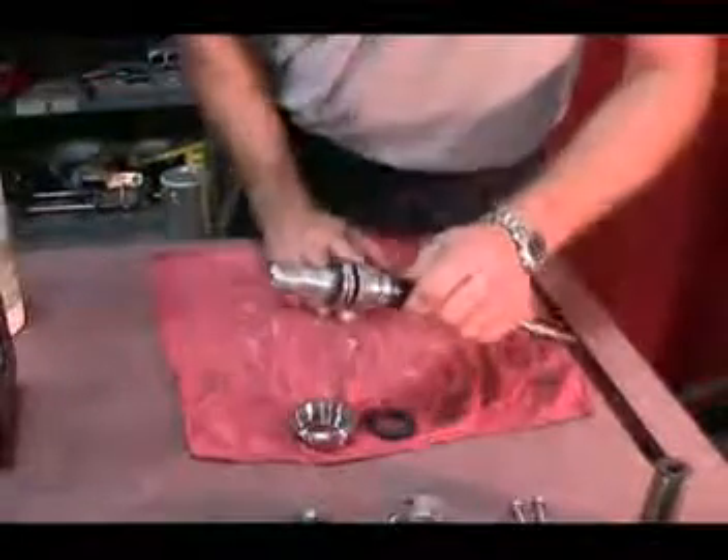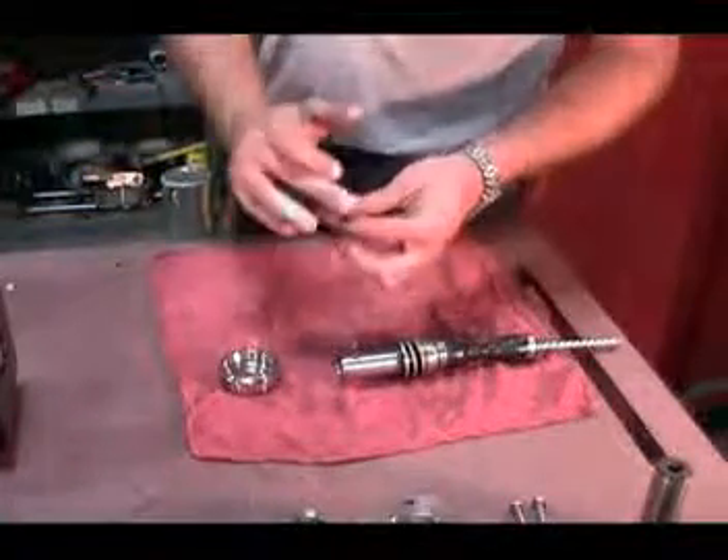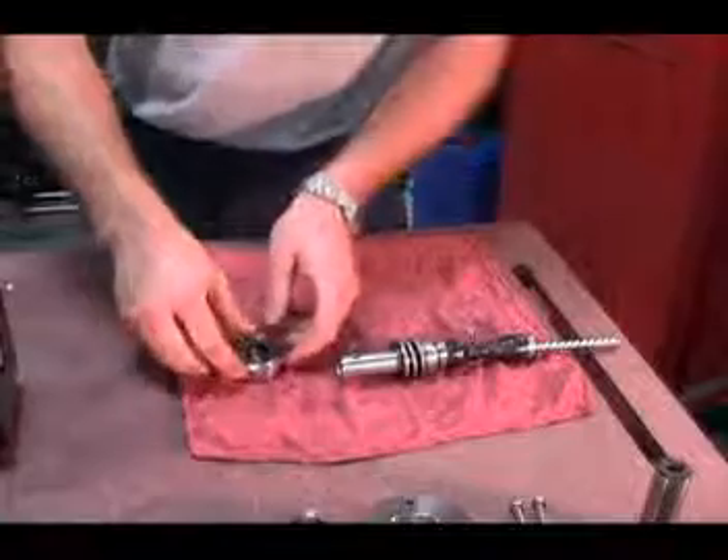Again using the P80 lubricant, grease either the rubber cup or the rubber O-ring that is going to slide inside the seal housing. It is important that when you install the stationary face that you push down evenly with both fingers.